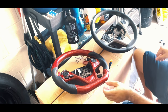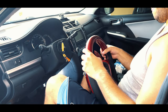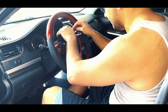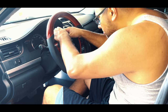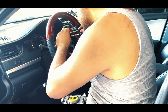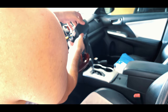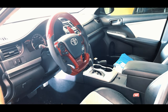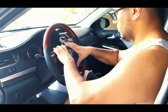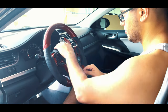After completing all those transfers, you can go ahead and get ready to install your new steering wheel. Before installing, spread out all the internal wires and run the airbag wires through the steering wheel. Connect all the loose wires to their proper location, then secure the steering wheel to the car. Prepare the ground wire, attach it to the airbag, and plug in both plugs. Now that we're ready to install the airbag back, remember those three pins need to be put back into place so the airbag installs properly.